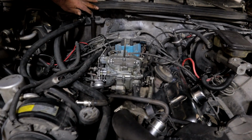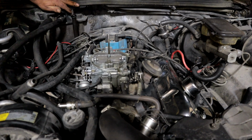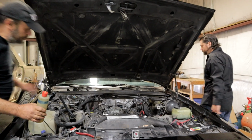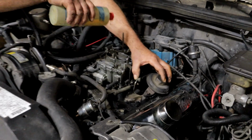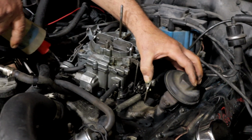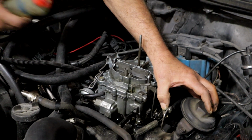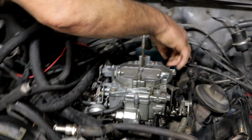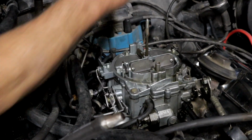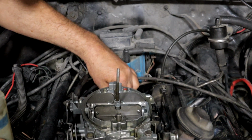All right, so the next thing I'm going to do is see if it's sealing around the intake. I'm going to take some gasoline and just trickle it around. And if we hear it smooth out, so, okay, fire it up again. Have something back here at the back of the carburetor. Alright, I can't really see. So this is where the power brake line hooks up. Okay, and that's loose. It's actually really loose. I had to find an adapter that goes in this adapter because it was different than the size. Yeah, I see that. Fire it up again.